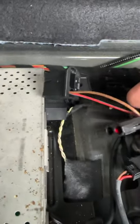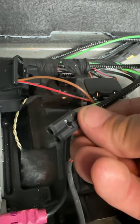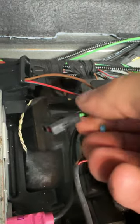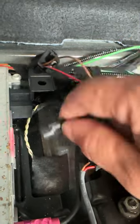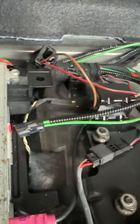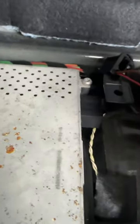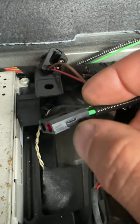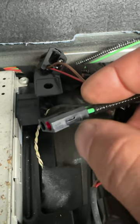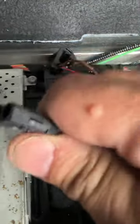There's a little blue piece — this little bitty blue piece here — that goes in this part. You can push it with a little screwdriver or something pointy from this side and pop this little blue piece out the other side. Once you do that, you'll see this little slot right there. Take a small flat head or something, push it in there, twist it a little bit, and you'll be able to free these wires out of that harness.